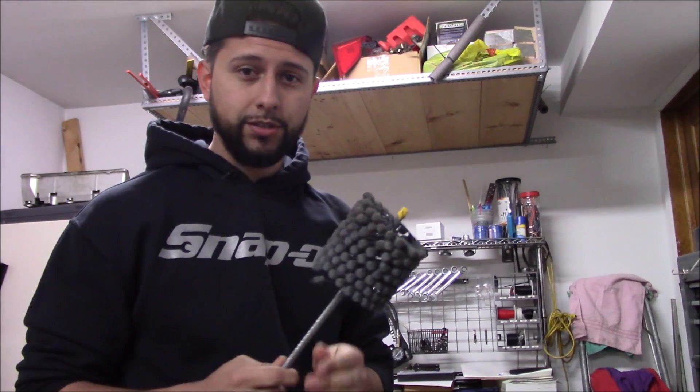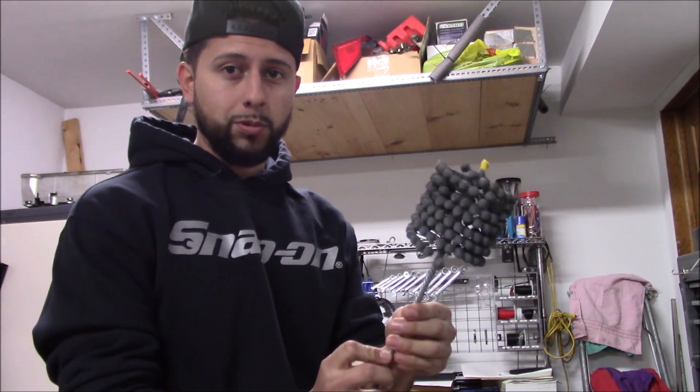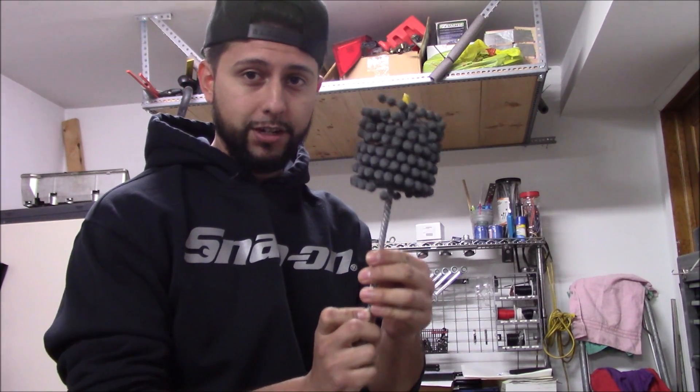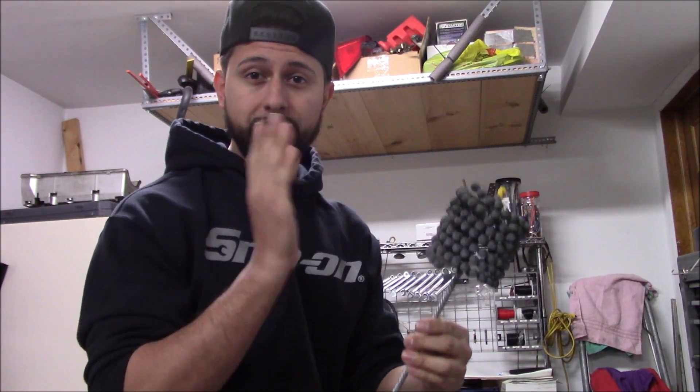My block is 87 and a half millimeters, so this fits just a little snug, which is perfect because we want it to hug the entire cylinder walls. The most important thing when installing this into your drill is it needs to spin almost exactly straight — you want no wobble in it when it's spinning. So I'm going to set this up in the chuck and keep adjusting it until we can get a straight shot.